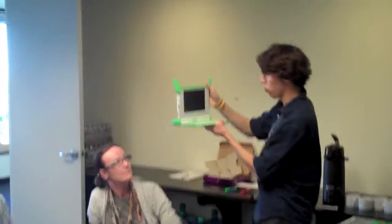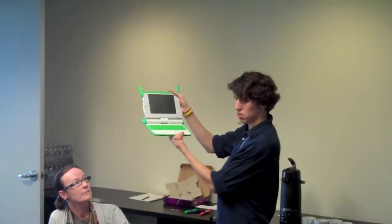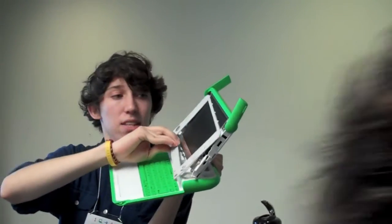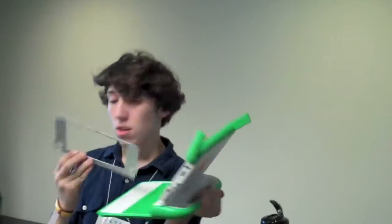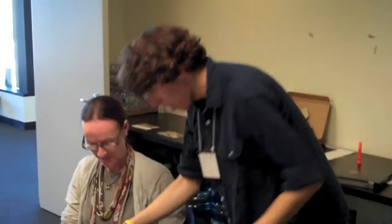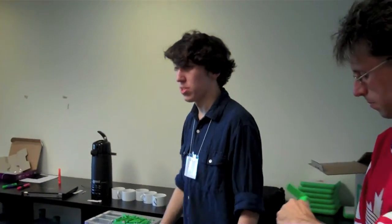Next, you want to rotate it so that the top half is parallel to the keyboard and tilt it slightly backwards. Then this front piece — the bezel around the screen — you pull it slightly out from the bottom and slide it down. Then there are four screws holding the screen in place, and you remove those four screws next.